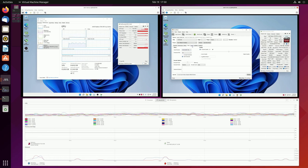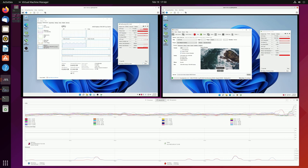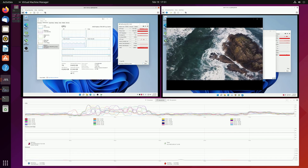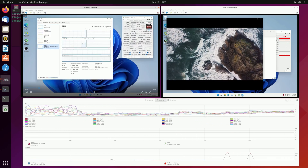This could be a perfect setup for a cloud gaming solution — one computer, one graphics card, but two virtual machines with a dedicated GPU for each. I also tried to assign one GPU to a virtual machine and keep one for the host machine, but that didn't work. If the PCI Express device is disabled for the host, I can't use it with the host; if it's enabled, I can't assign it to a virtual machine. If you have more info on this subject, feel free to join my Discord and share your knowledge.